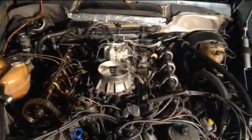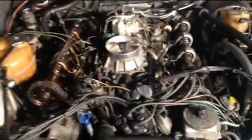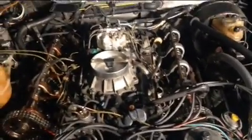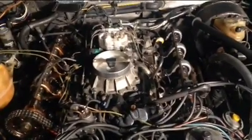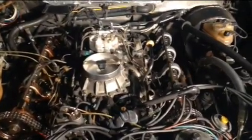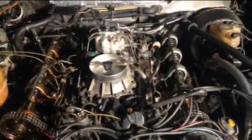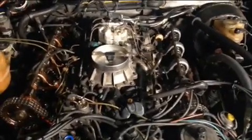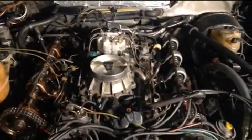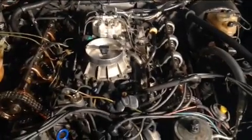So basically I started to go through the process of elimination, and in the first video I was talking about checking the battery first. After you've got the battery, you make sure that you've got fuel. After you've got fuel, you make sure that you've got spark. And of course, all of that comes after the simple things, like checking fuses. If something's still not happening, you may not have enough spark, and then it might be a coil, or you may have a loss of compression, or it might be many things combined together, and that's where I'm getting to with this car here.